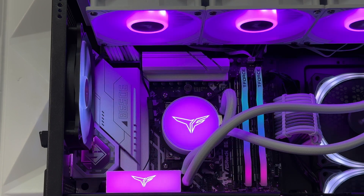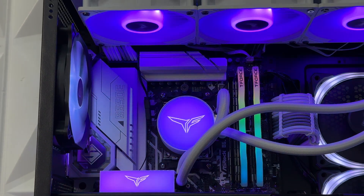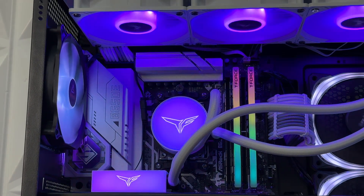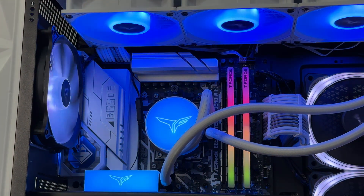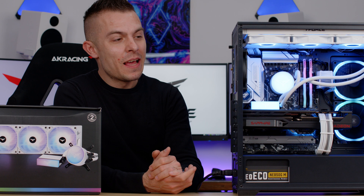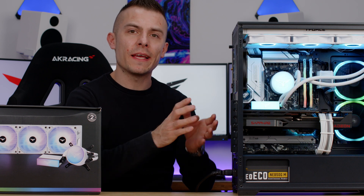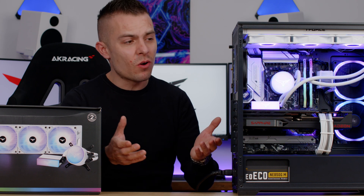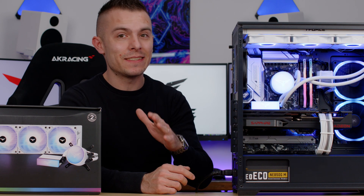To conclude: for those who struggle with cable management, the tubes may look confusing, but they're actually very straightforward and it's easy to place the SSD water block. You do most of the work outside of the case — placing the SSD into the water block — and the rest is just placing the CPU water block, then mounting everything on the motherboard. After that you only need to connect the pump and the addressable RGB lights, and that's all there is to it.